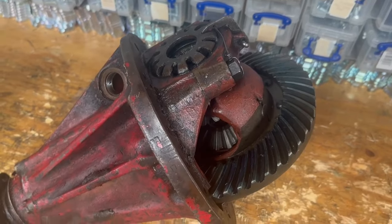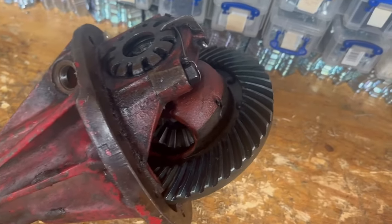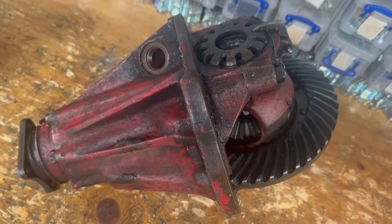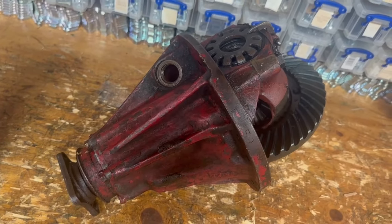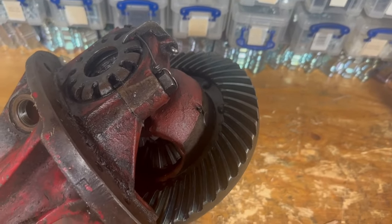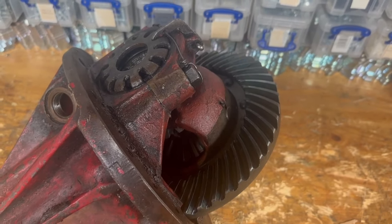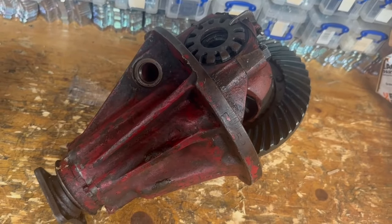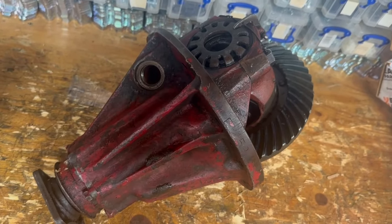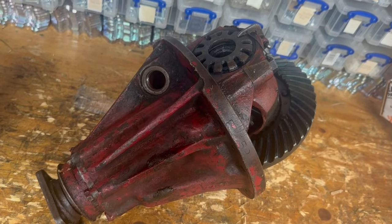So we're going to see what we can do with this for him. First job is to get it completely apart, get that really filthy dirty crown wheel in the ultrasonic, and clean all the other bits up. Basically this has got to look original on the outside, but on the inside we can beef it up with more modern bolts, lose all the locking tabs, and put better quality bolts in. We're going to reuse the crown wheel because he wants this for the front and doesn't want to spend a fortune on one of our lovely brand new old stock Series crown wheels.